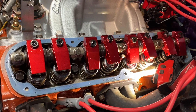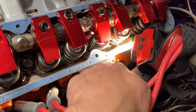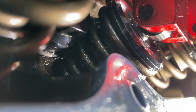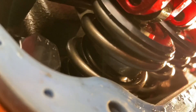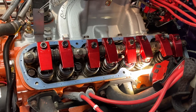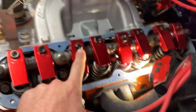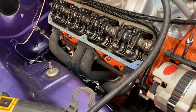Got the driver side set - the valves are adjusted now. I checked the sweep pattern and it looks really good. Here's number five exhaust, currently compressed - see where that roller is? Exactly centered on that exhaust valve. Looks really good. Number one looks pretty nice too. This is much, much better than the other set I had on here. These lack about one thread from being totally level, but that's really nice. I'll go ahead and pop the other side's covers off and get those set, so she should be running shortly.